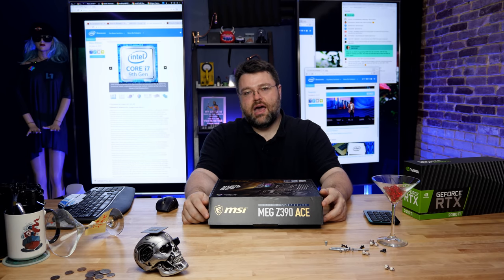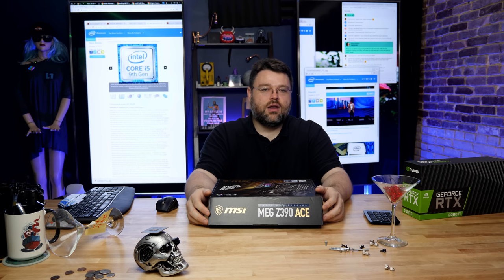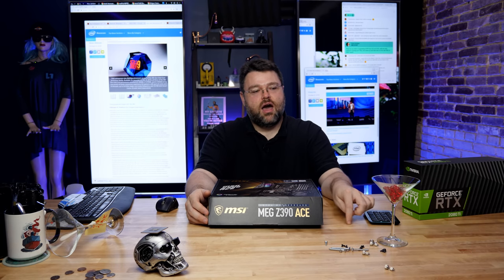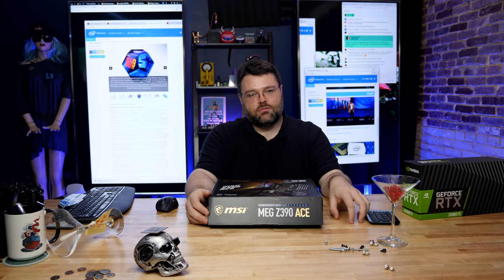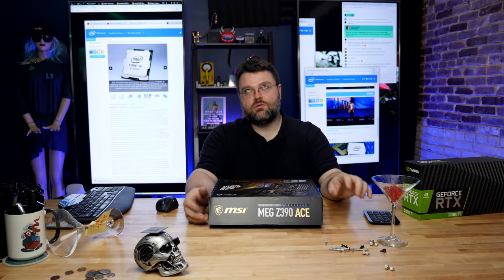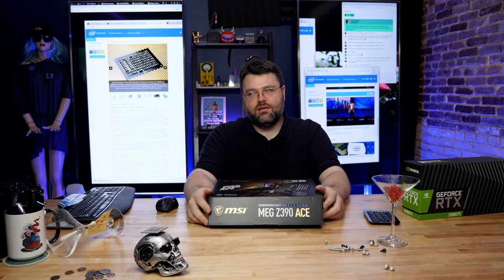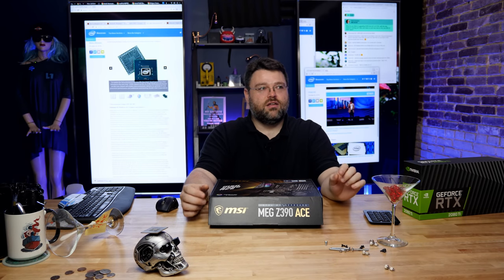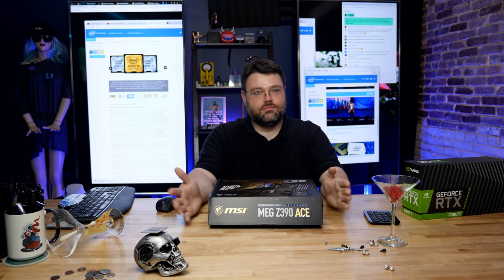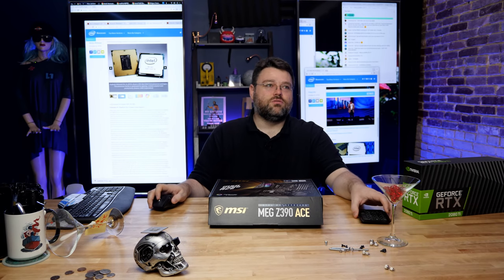But the i9 also has more cache, and more cache means that you've got fewer trips to memory to worry about and deal with. So maybe it doesn't matter. Maybe this is a market segmentation thing. I'm really not sure. But you should keep in mind that a hyper-threaded core is really only worth about 10 to 25% best case scenario of a real core. So on the 6-core, if you disable hyper-threading, it's like losing about one virtual core, maybe. I mean, depending on how you swing. I mean, not really. I'm really oversimplifying. But I really think that the 1151 platform wasn't really designed for 8 cores, and this is just Intel saying, okay, well, we're gonna do 8 cores and, you know, soldered cooling and all this kind of stuff. So that's just my own 2 cents.